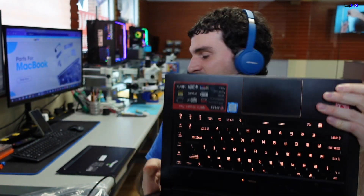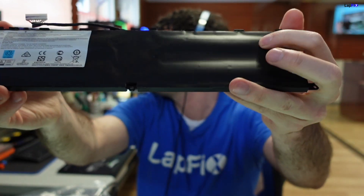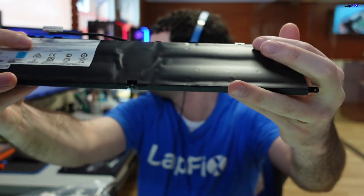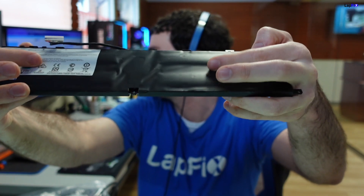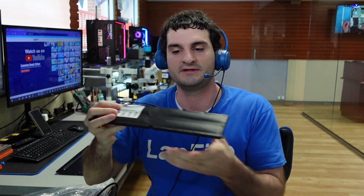So it's turning on, and there was a problem with it charging. The DC jack was actually a little bit loose in there, so we did do a repair for that. Also there was a swollen battery, as you can see here. It's easy to tell — you can see it's a little thick at the top. See these lumps on either side? That means the battery is expanding. Usually there's a chemical imbalance in the battery so the battery expands, and eventually it can get worse — it can burst. You don't want that, so we properly dispose of it and do a replacement for the battery.